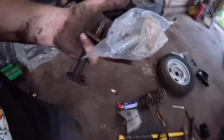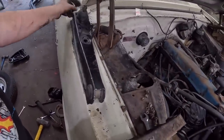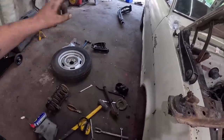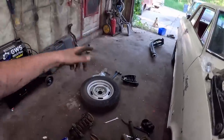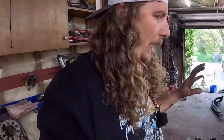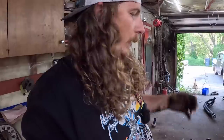We'll put the lower control arm going very quick and very easy. And then we can hopefully pull in that top stud. It was splined and tight and hard, and I had to get the torch out, and it was quite an operation. But I'd like to get that all kind of back together, just so it's sitting there, that we can work on the other side, and then really know where to leave this.